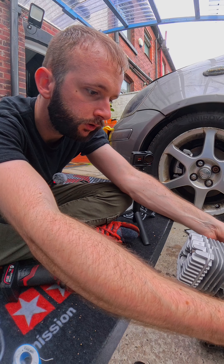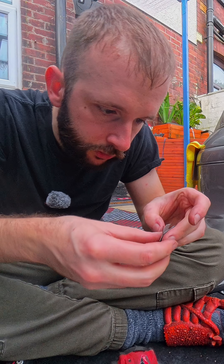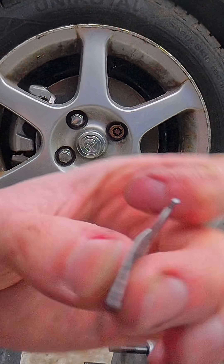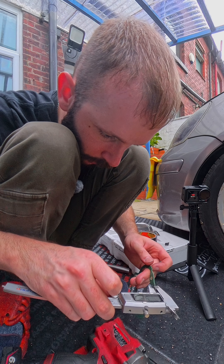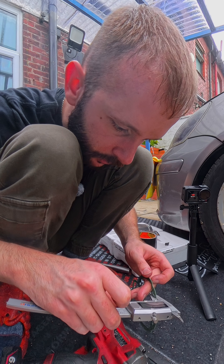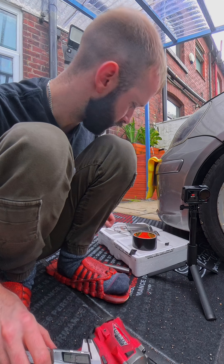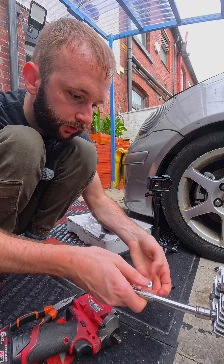Now let's try to see if it's touching. Here it is — oh yeah, squished it pretty good actually. Okay, let's get the digital calipers. You can see it's been squished. You need to add 0.3 on top of whatever this gasket is, so this is 0.5, so we need a 0.8 gasket for 0.8 spacing.